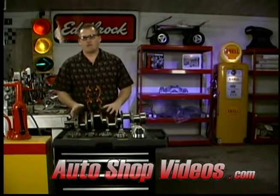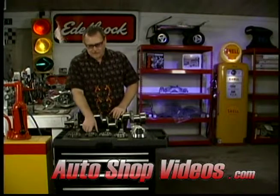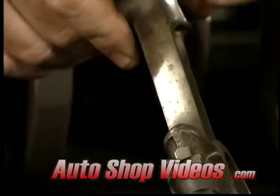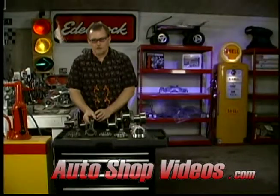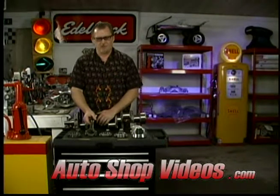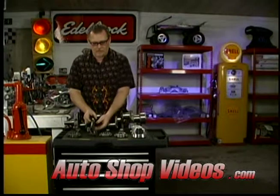Most factories used a forged rod, including all the Fords, Chevys, and most of the Chryslers. This next one is an early Chevy rod — it's been reworked. You've heard people say they polished the beams and stress-relieved the rods, calling them Chevy pink rods and claiming they're stronger. Nope. Chevy pink rods are only pink because they were magnafluxed at the factory to check for cracks. It's still the same rod as any other Chevy motor. By polishing the beams it does relieve stress risers, but the rod is still made out of the same material.